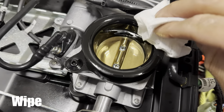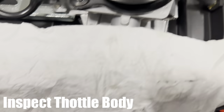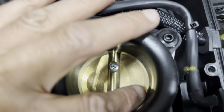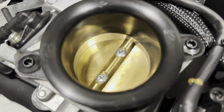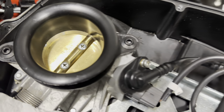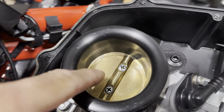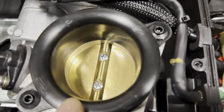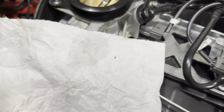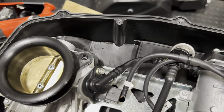Just got my kitchen towel, I'm going to slowly clean around this. These weren't too bad - the tissue isn't showing too much crap on it. The surface of this isn't very smooth, it feels dimply - I don't know whether it's supposed to be smooth, you can see some little pits in it. The front cylinder, the one that tilts down at an angle towards the front of the bike, was relatively okay - surface feels smoother than this side. This side definitely looks more pitted.